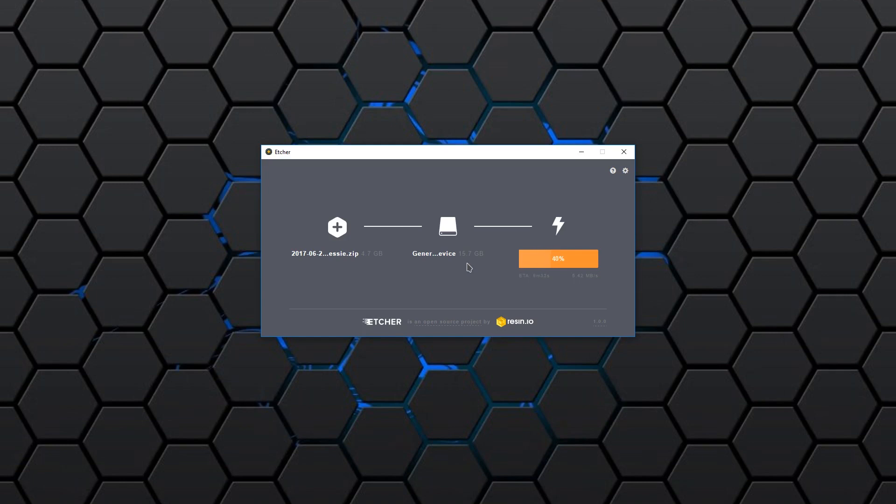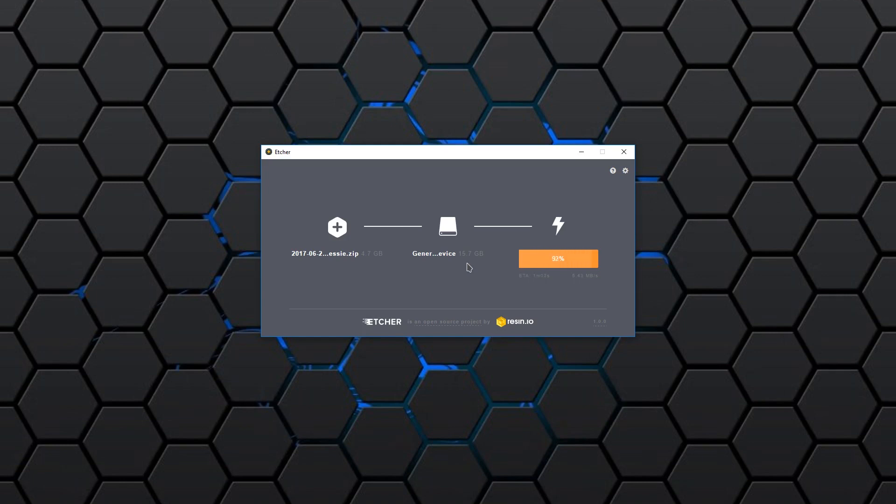To begin, we're gonna need a Raspberry Pi, an SD card, and a USB hard drive. Go download the latest image of Raspbian. As of April, this is officially baked into the kernel, so you don't have to do all the next branch and all that stuff to the kernel just to get this option. Once you download it, burn the same image onto the hard drive itself and onto the SD card.